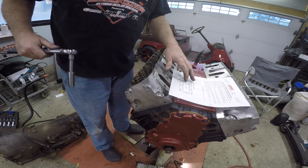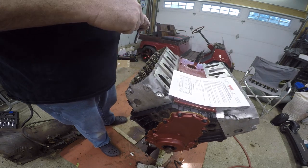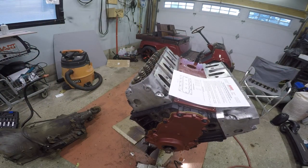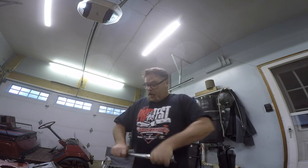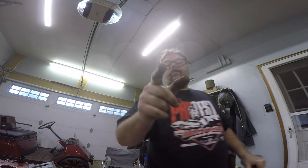So now we gotta go up to 50 pounds. Which we can use this one still, I think. Sure can. Oh, God, I can't torque with this thing. Okay, you need to walk away from this ASAP. What? I need 12 points, boys. So we're gonna have to go out and get some 12 points right now because I got the gasket goop on. Okay, so I'm gonna stop the video there, run out, grab myself some 12 points right now, and we'll come back and get these torqued up. So there we go, put that back to zero. Never forget to do that.